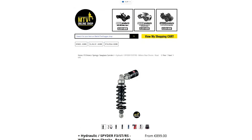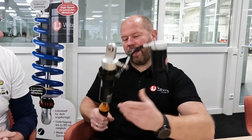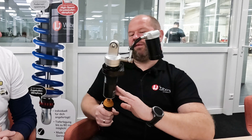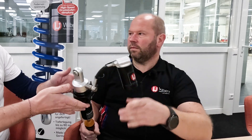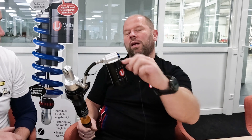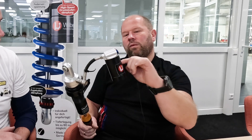The reservoir you need for special high-movement applications — it's a piston rod, especially for motocross bikes or race bikes. We have high temperature in the shock and we need to separate the oil from the gas. This is the reason we need a reservoir. So we have oil in the whole shock, and here it's gas under high pressure. We have here a little bit — 10 millimeters of oil also inside — then we have an aluminum piston, and on the other side we have gas pressure: nitrogen.